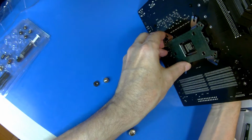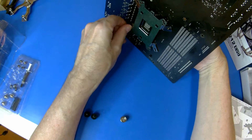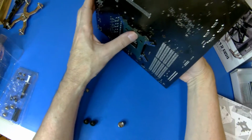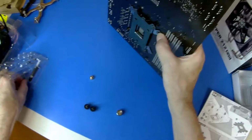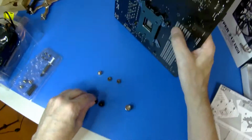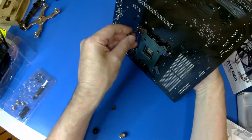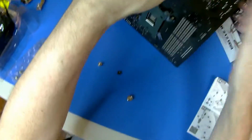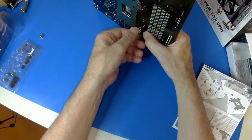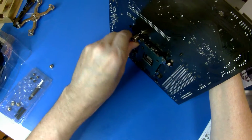The bolts didn't go easily through the holes here because the first bolt had slipped from the center to a different hole. Screw all the nuts on finger tight at first. There's the sockets to tighten them. Once you have them all finger tight so they won't slip, you can lay the board flat and tighten them up. Tighten opposite corners according to the instructions.